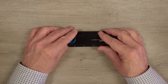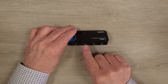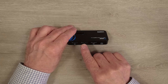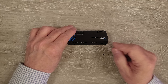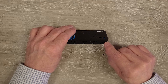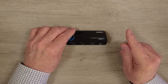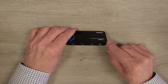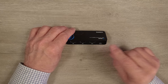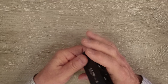On the rear of the unit is where you'll make all your connections. Starting on the left you'll find HDMI ports labeled input 1 and input 2, which connect to whatever media devices you'd like to share across that single monitor. The output port gets connected to the monitor you'd like to view that content on — these are all standard HDMI connections. To the right of that is a DC input port used with the included cabling system. You'll connect the USB-A end of that cable to any standard USB wall charger or any available port supplying 5 volts, and the micro USB end plugs in here to supply all the power needed for switch operation.